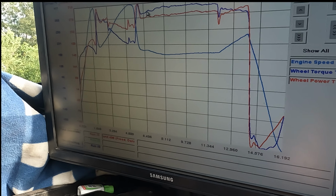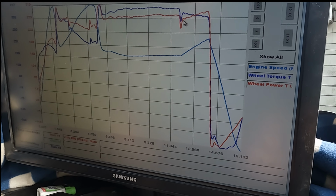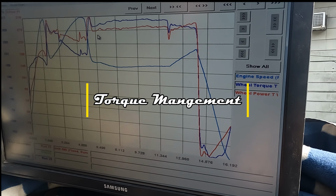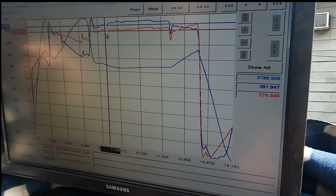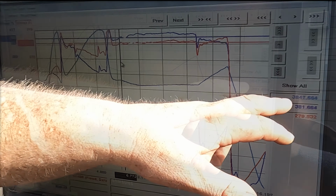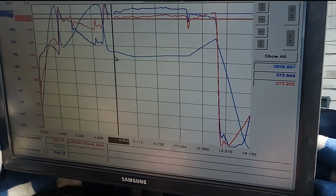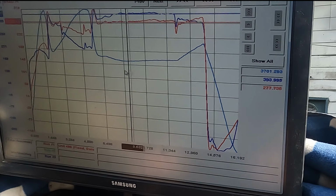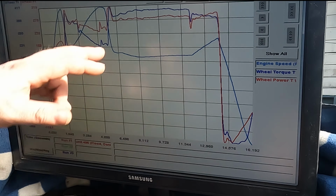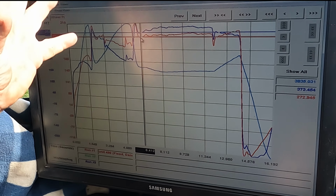Yeah, a little bit. And that's still third gear. We hear it just kind of hitting that, and almost like it's hitting a wall. Right. Which likely could be just the stock tune. You know, it's hitting that spot and just saying, oh, we don't want to work anymore. But it's still working. It's doing 380 to 400 foot-pounds of torque, then it dropped to 37. It's making some power though. Yeah. Well, it stayed in gear, and then it did shift into third though. It shifted into third, and then it started like bogging. Yeah, and that's what I was noticing, it hit and it kind of locked in its gear. Yeah.